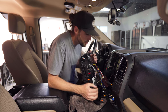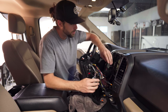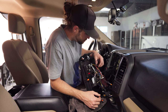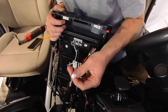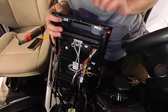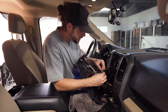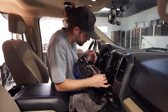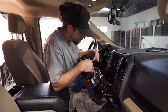To make sure the steering wheel controls and volume knob work, there are a few key connections. The yellow and blue single-pin round connectors do not get used — tuck those back. The antenna connects to the black wire. The micro USB is key. In the main wiring harness find the small white connector, put the tab in the downward position, and pop it in — that's where you get all your steering wheel controls. There's also a blue wire with two ends — push those together for a solid connection.